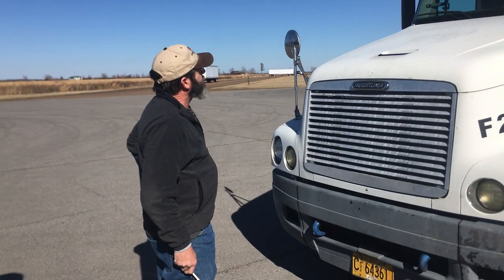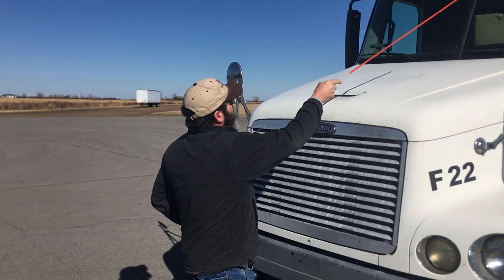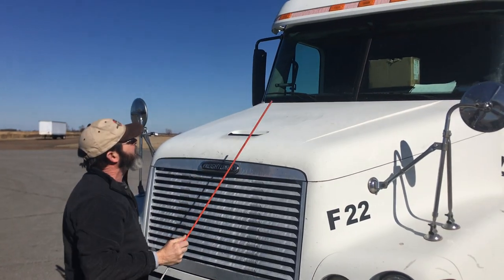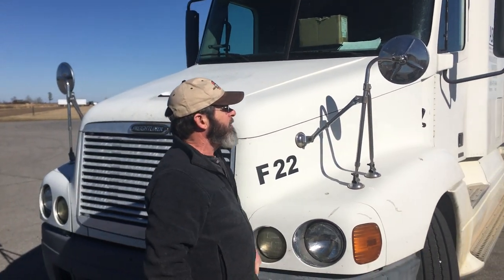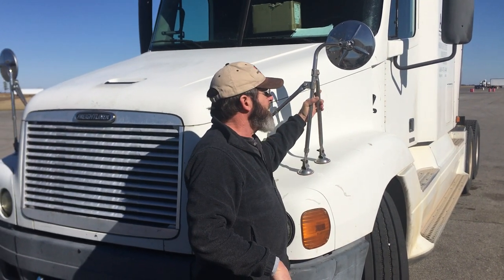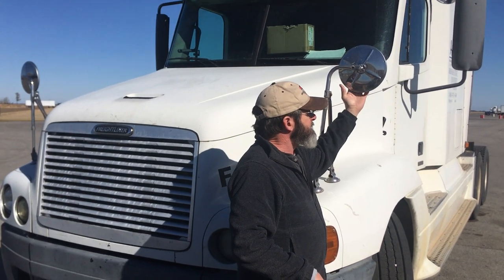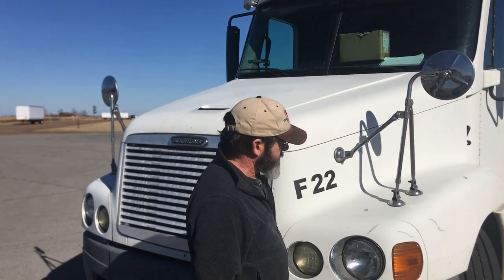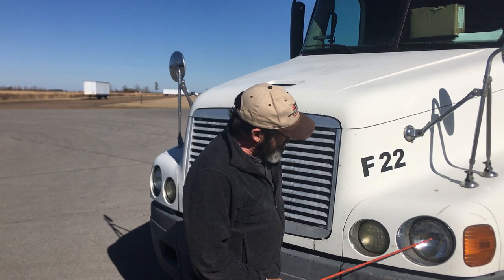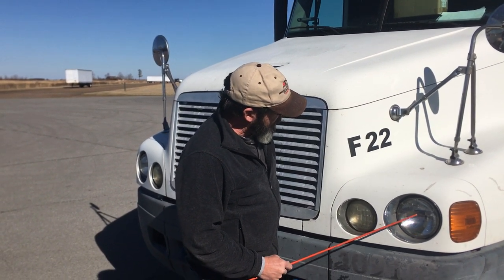You come and start the front of the vehicle after the in-cab check. I start at the top and work my way down. Clearance lights over the windshield — cover's not cracked, broke, or missing, amber in color. It only says mirror, but I always check the fender mirror just to be safe. The fender mirror is securely mounted, not cracked or broke, not excessively dirty, adjusted for me. My headlight is here — cover's not cracked or broke.